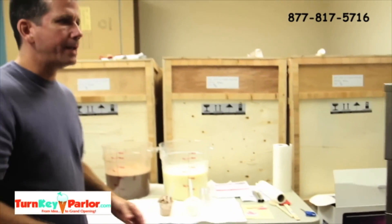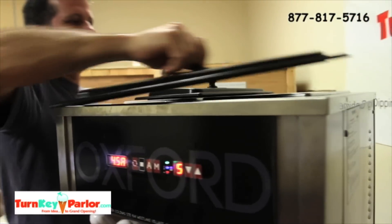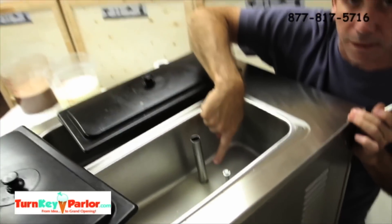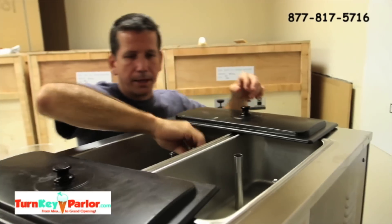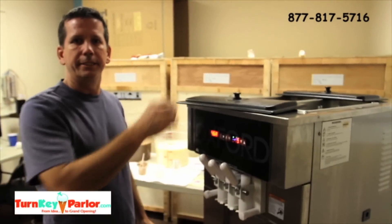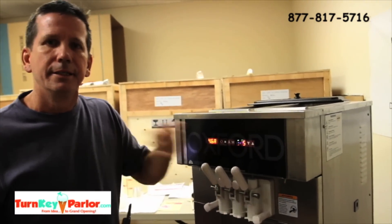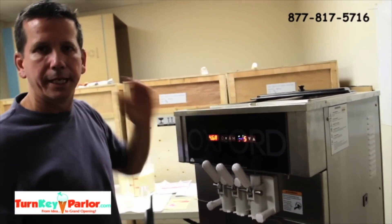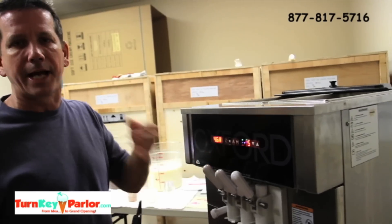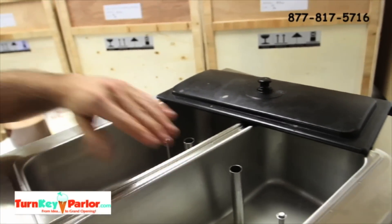Now we can go ahead and put the air tubes back in. Make sure that the little hole is at the bottom — that's where the product feeds through. If the machine is ever squealing really loud, it means you put the tube in upside down by mistake, so product's not feeding into the cylinder. You can hit the stop button and get some product in there. To protect the machine, hit stop. If it squeaks and you don't stop it, it'll eventually shut itself down and take about ten minutes to restart — it goes into reset mode. So make sure the holes are at the bottom.